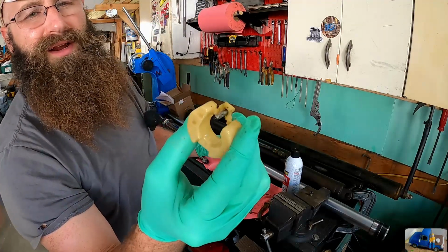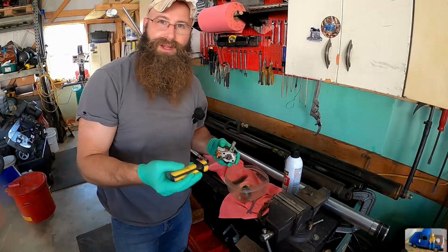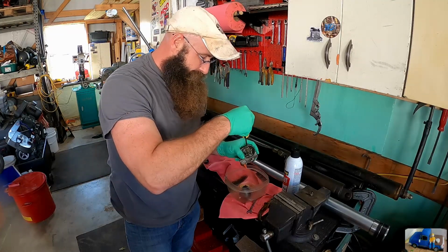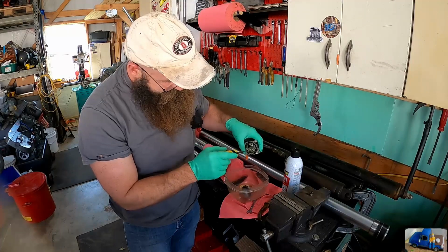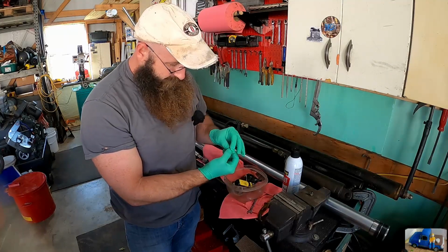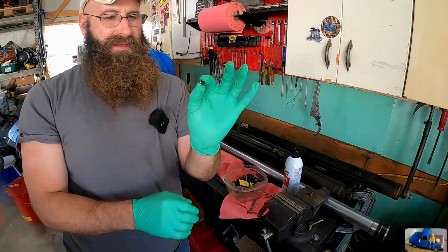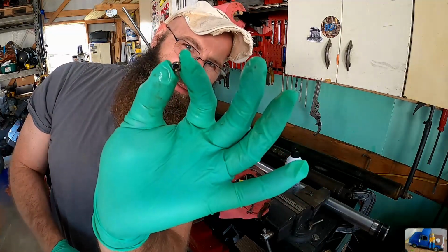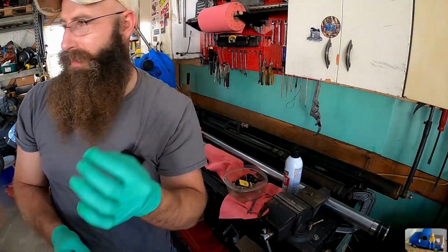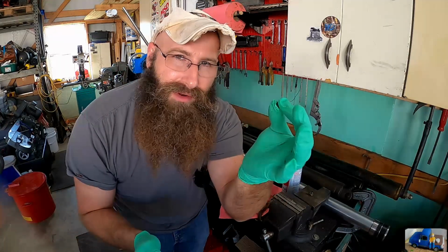There's a little rubber needle there on the end. Still trying to get used to all the tools being up there. This guy's pretty crusty. I don't know if you can see through there with the resolution or not. I mean, it's still open, but it's kind of gummy. It's like the orifice closed up a little bit. It's pretty crusty in there, so it probably wouldn't run right if we didn't clean that.